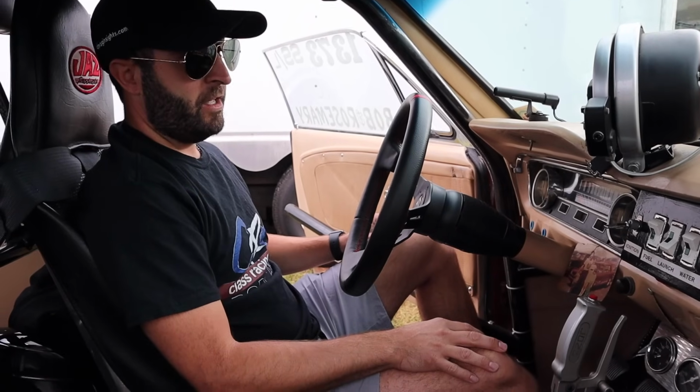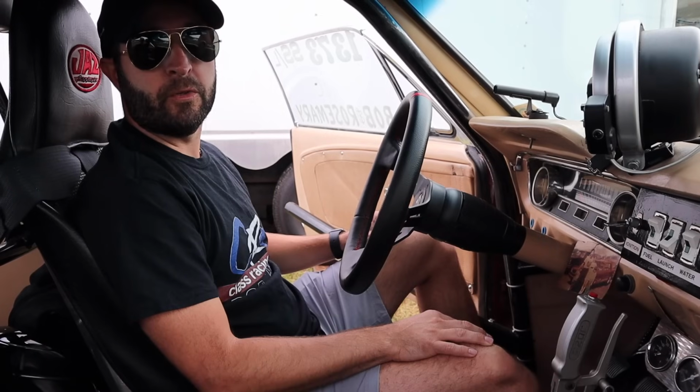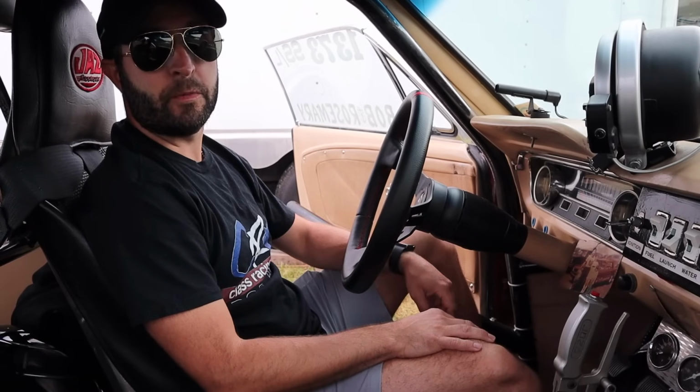The rear here, we have a Ford 9-inch rear built by my dad, Bob Fazio, and we have a pretty steep gear ratio, if you will. We run a 620 gear in this car. Wow. And a 329 first gear. So we really turn the RPM in this car.